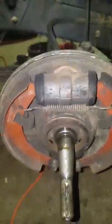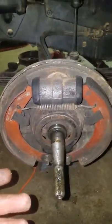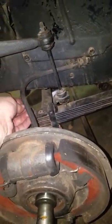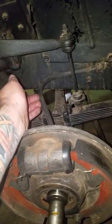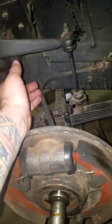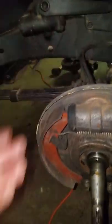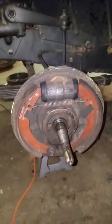The reason I'm checking these is because it's a brand new vehicle to me — not that it's brand new because it's 1933. I ordered new brake hoses mainly because of the rubber, and your braking depends on this. In order to make sure you're going to stop — if you've got family with you, friends, or if you care about your own life — you want to replace this stuff. You could go steel braided if you really wanted to, but let's be real — these are drum brakes. You're definitely not stopping fast; you need to account for that braking distance. Drum brakes, yeah, they kind of suck.